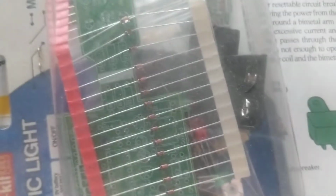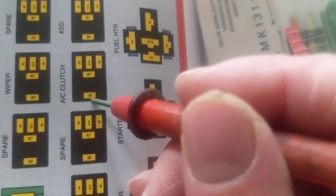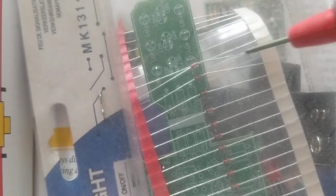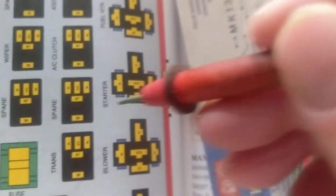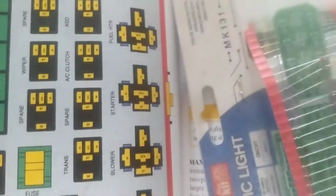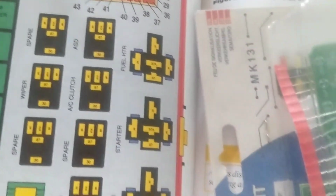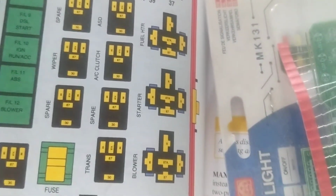So therefore, you'll see it, hopefully, like I said, hands-on will do it, then you'll understand it. If I have this resistor, I take this resistor, I attach it to, let's say, this one. I put the relay back on top, and guess what happens? The other end of it is being exposed to me, and then I can go and measure the voltage in circuit. That's the most important thing, is to measure it in circuit.